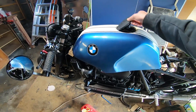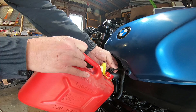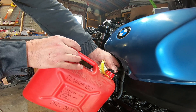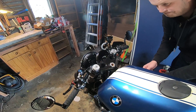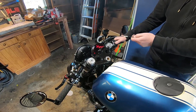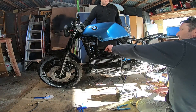We've got some fuel in the tank. We're going to fire up that fuel pump with the return line disconnected — we just want to see fuel come firing out of here and catch it in this container. Key on — beautiful, it just comes shooting out of there. Here we go: key on, no leaks that I can see. First attempt, not the 31st.